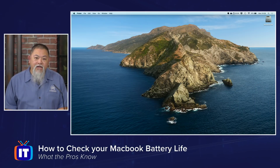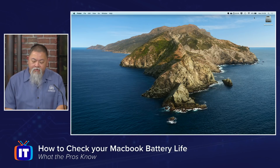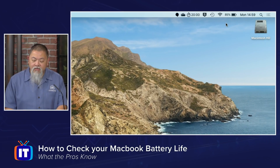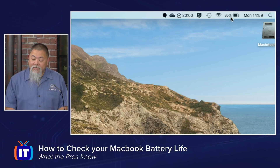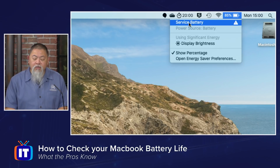MacBook Pros are relatively good with their battery life, but sometimes you will see strange behavior with your battery. I started noticing this one day when I was using my MacBook without it being plugged in — it was charged to 100%, but it actually drained relatively quickly. Right before I walked into the studio, about 15 minutes ago, it was charged to 100%. Now notice it's at 85%. That's a relatively quick battery drain — about a percent a minute. I clicked on it and saw a warning that says 'Service Battery,' with a little warning symbol.